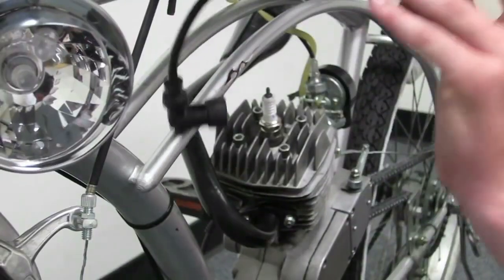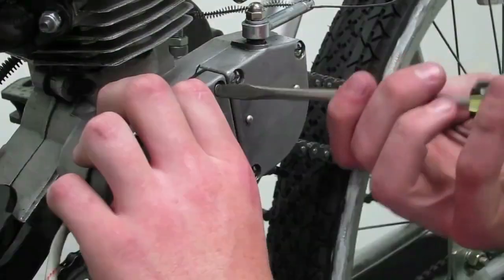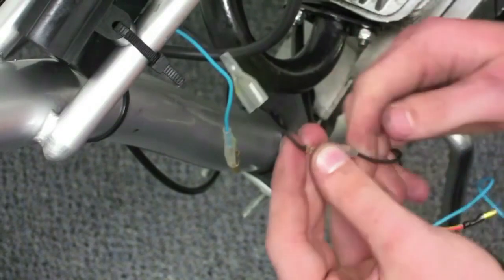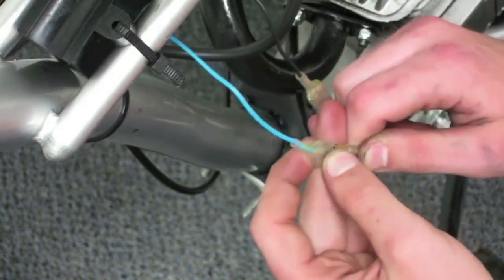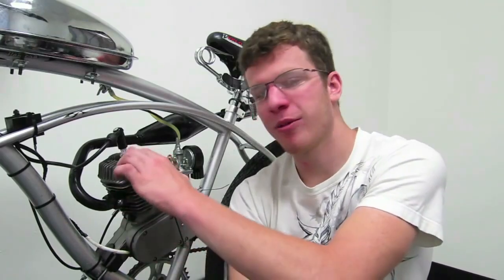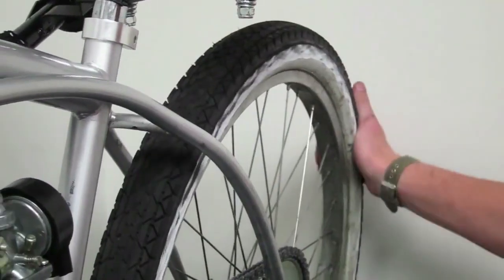With the electrical components, there are three electrical parts to the engine: the spark plug, the magneto loop set, and the CDI. The CDI can be mounted anywhere on the bike as long as it can reach the spark plug. The spark plug is placed on the head and the magneto loop set sits inside the engine. When it comes to wiring, you may need to splice the wire, which involves cutting and stripping the insulation away from the tip. Otherwise, it's pretty simple — just plug in the male to the female end. Connect the black wire from the CDI to the black wire from the magneto and the green wire from the kill switch; these are your ground wires that complete the circuit. The blue wire from the CDI connects to the blue wire from the magneto and the red and yellow wire from the kill switch. You can check if you're wired properly by moving the spark plug and checking for spark — make sure it rests on the head cap to ensure visible spark. Rotate the rear wheel while engaged to create spark.